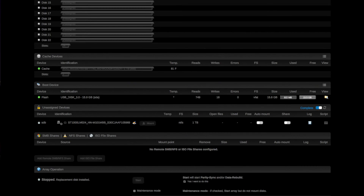I'm starting my array and it's going to go through the normal array start process. Mounting disks will take a little bit longer than it would normally because this is not a normal operation — it's what I guess in the airline industry they call an irregular operation; we're trying to do some recovery here. Starting services. You can see it's now mounted that as my disk four. If I highlight over it — green: normal operation, normal operation, normal operation — but when I get down to disk four it's orange, which indicates there's something different about it. That orange triangle means 'device contents emulated.' That means even though that disk does not hold any actual data right now, we're rebuilding it. If you look at the bottom, it says 'parity sync data rebuild 0%' — it's going to take a while, but it's rebuilding that drive.